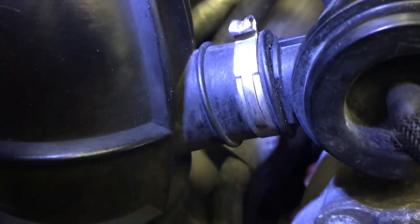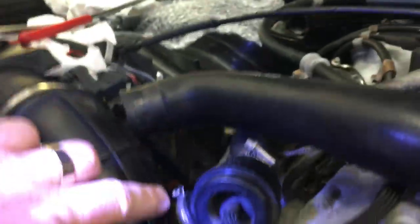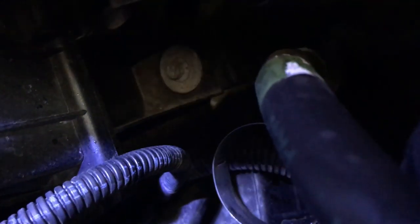You can see that this side is completely clean and completely pushed up. However, if you come in the side down this trunk of this hose, your air cleaner box is down there and there's a hose clamp down there, and the air box is unclipped. There's a clip right there in the shadow — it's unclipped. So you may want to keep that in mind and have your technicians check for that.